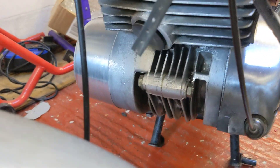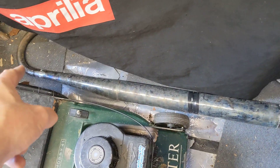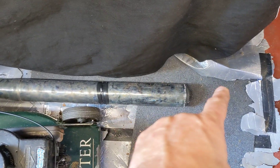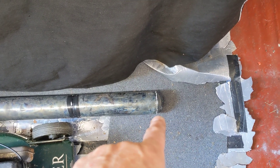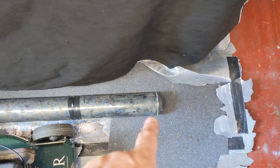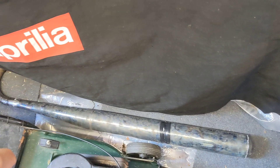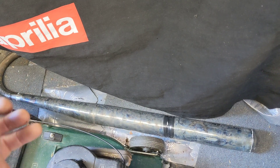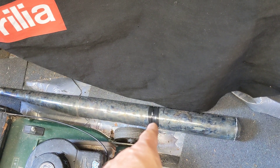I did take the exhaust off because somebody said it could be the exhaust is coked up — that's why it's not holding maximum revs. So I took the exhaust off and decoked it. I put a hot air gun in one end and then used a blow torch to heat it up — hence the bluey pattern on it. It smoked like a big fat cigar for about 40 minutes. When it stopped smoking, I plugged the end, filled it with caustic soda, got it nice and hot — 45, 50 degrees — got rid of that and done it again. And then where that tape is, it sprung a leak.